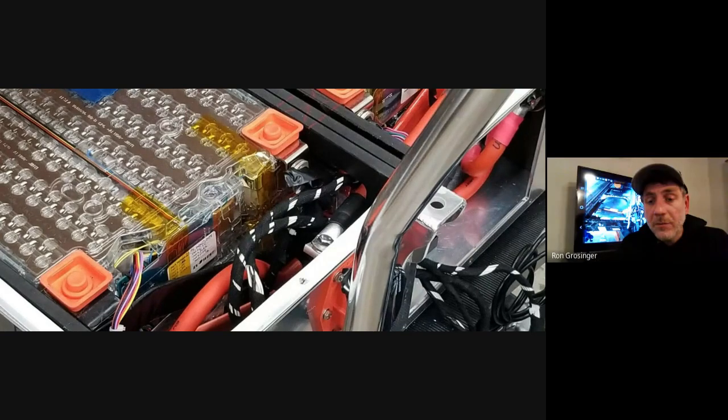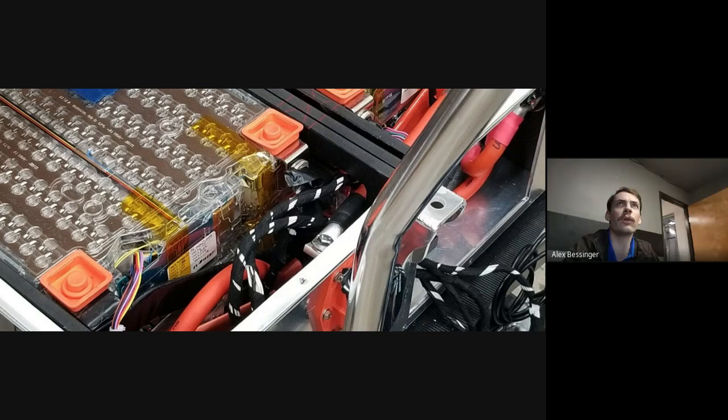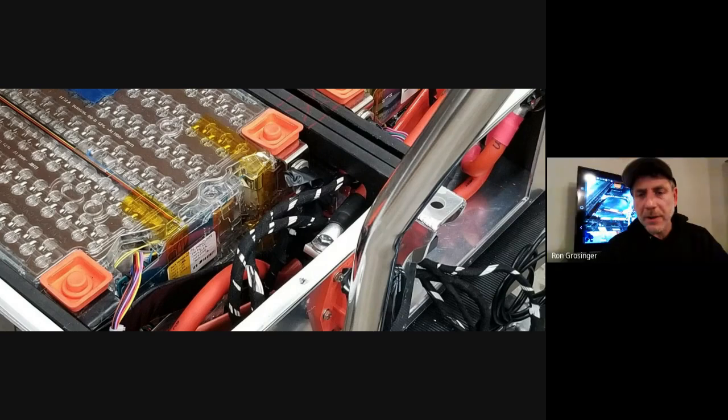So do you have lower voltage, top voltage? Yep. So my pack is only an 84S pack. Oh, so what's the bottom voltage that you could be at? The low end voltage would be somewhere in the low to mid 200s. I don't know exactly off the top of my head what the low voltage cutoff is. That's okay, give us a ballpark.